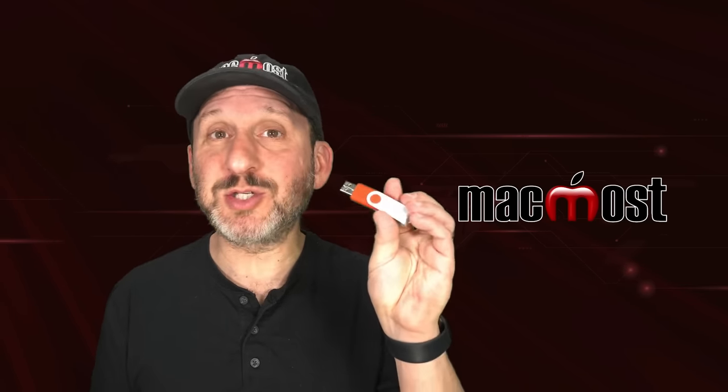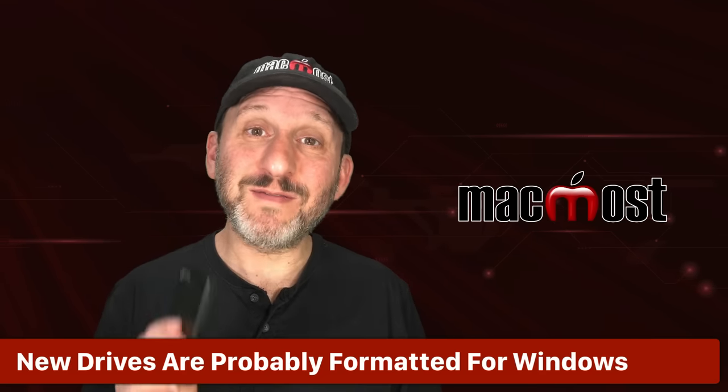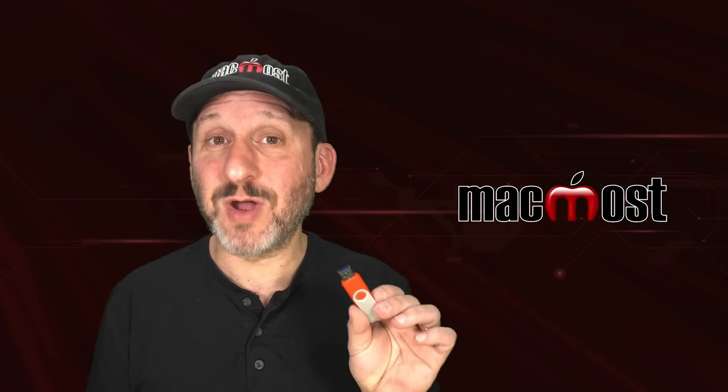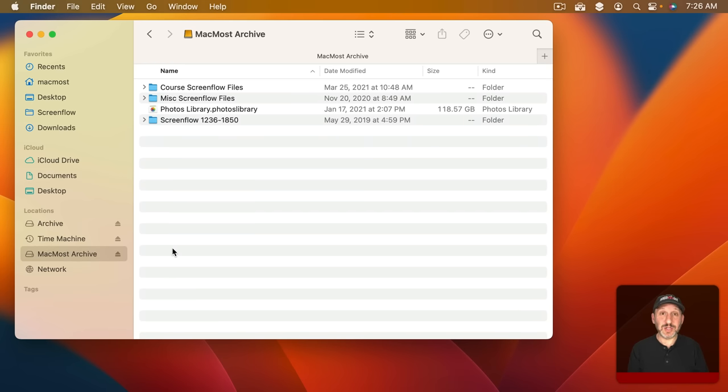When you buy an external drive, whether it's a large hard drive or just a small USB thumb drive, you need to format it for your Mac. Even if the drive says it's formatted for Mac, it may be using an older format. Most of the time when you buy drives they're actually formatted for Windows. When you connect a drive it should appear on the left side of the Finder under Locations. It's not a new drive but I'm going to use it for this demonstration. If you select it, it shows what's in there — chances are if it's brand new it should mount just fine, maybe showing no files or some junk software included with the drive that's probably for Windows, not for Mac.